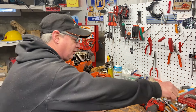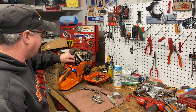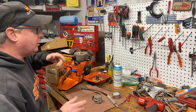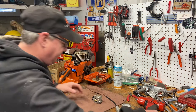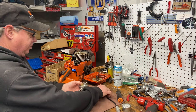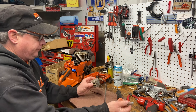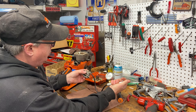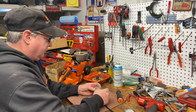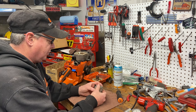Let's go over the carburetor — that's the lung of the engine. I know the fuel line and fuel filter are good; I pressurized them and visually looked at them, so it's good to do both. Let's get our screwdriver out and pressurize it up first — make sure it's holding pressure. Ten pounds, holding, no problem. There's probably nothing wrong with this, but I'm going to check it over since I'm doing the whole rebuild.